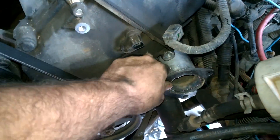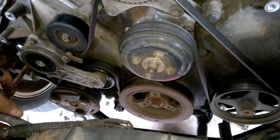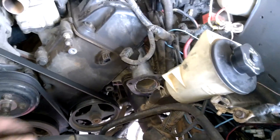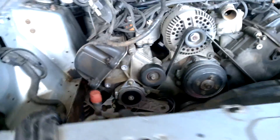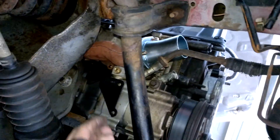I'll be making similar fittings here — probably make a couple of radiuses, bring that pipe over, do the same thing on the other side, bring them together and come up to the turbo. The really hard part was fabricating those two exhaust manifolds, and they are done. Pretty cool — this is just sitting on there loose, but see how that worked out.